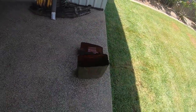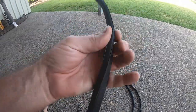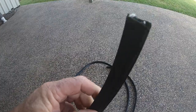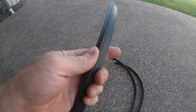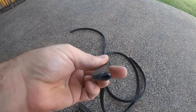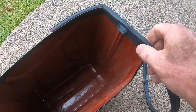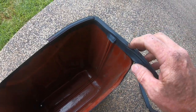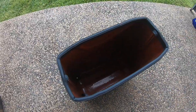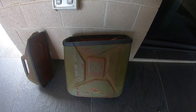Then I'll put the pinch weld on. I've got two types here: one with a balloon at the top - about five or six mil - which I'll stick on the bottom part of the jerry can. Then I've got a solid one for the top. Because the inside of the jerry cans has a little ridge, I've trimmed a small cut on the inside of the pinch weld so it fits in. Just go around with a little rubber mallet and tap it all the way around to make sure the pinch weld is seated - don't hit it too hard or you'll bust the seal on it.